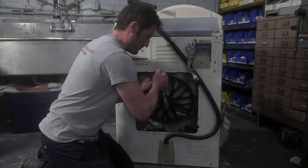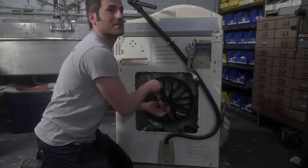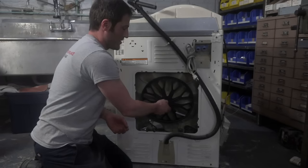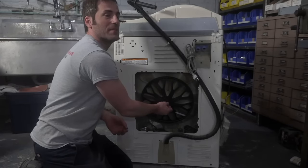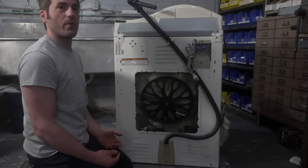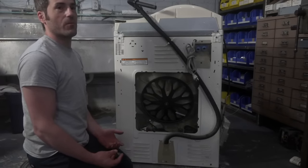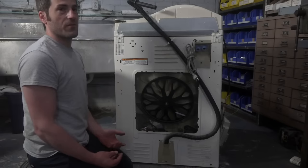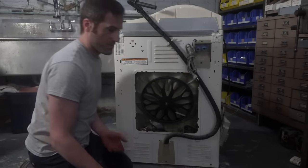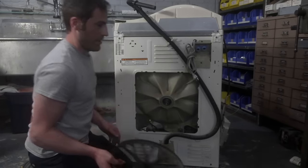Eugene, would there be another name for this fuse? What's that? Capacitor, maybe? Not capacitor. It would be cutoff, thermal cutoff. So look at the parts diagram and see if the cord plugs into some sort of power board. And if there's a fuse on it, it's on that power board, but they might not sell the fuse separately. He might just have to open it up and it might just be a regular glass fuse. Okay.